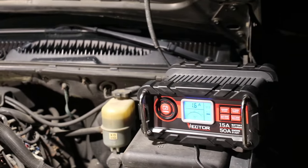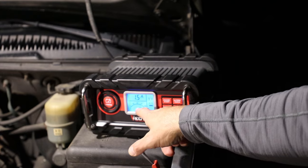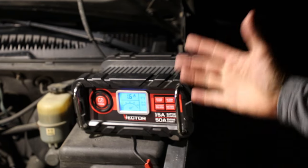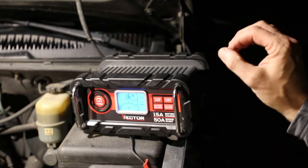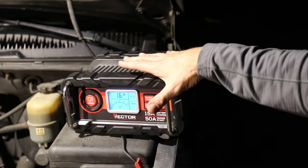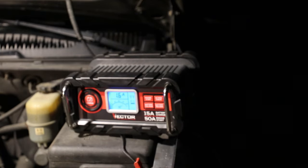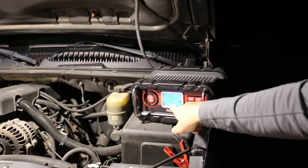Now it's been just over two hours and it's still not all the way charged — we're at about 85 percent. If you look at the rate, it's 1.5 to 1.6 amps of charging, so it's way down — it's trickle charging. I think that's the most effective way to fully top the battery off. If I disconnected it now the vehicle would start, but to be fully charged for winter I want to make sure it's completely topped off to 100 percent.